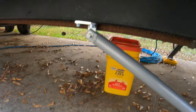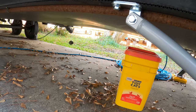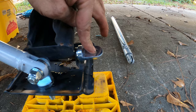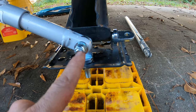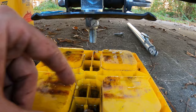I'm having a little bit of complications, but I'll get to that in a second. These right here are drilled and tapped — I drilled them with a five-sixteenths and then I tapped them with a three-eighths inch, so those are in there solid. There's only one spot to connect this bar eye bolt right here through the jack pad, and this front one I'm gonna have to take and have it welded in this position, or I may just cut this excess part of the bolt off.